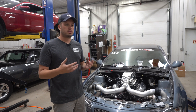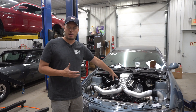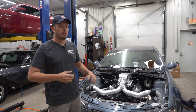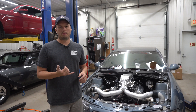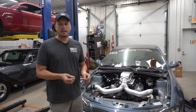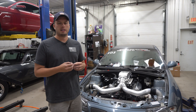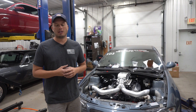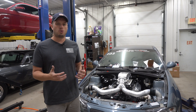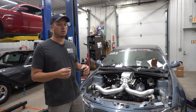These are very efficient and make a lot of horsepower comparatively to something that runs all the way inside the car and all the way back. If the horsepower and boost you're looking to make is capable of being controlled by that style of intercooler, it's a definite advantage. As far as my personal preference on gasoline versus methanol — this is a street car, so I prefer to just run gasoline. Ethanol takes about 30 percent more fuel, methanol takes about double the amount of fuel, so it's a way less expensive fuel system. Maintenance is so much lower too — on a methanol car the injectors need to be serviced often, they dry out fittings, o-rings, and hoses, and you have to change the oil a lot more often.